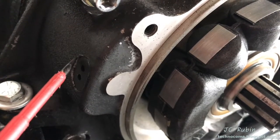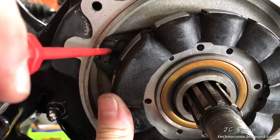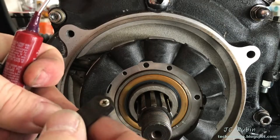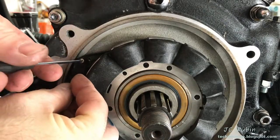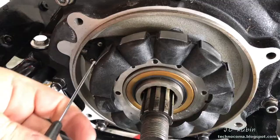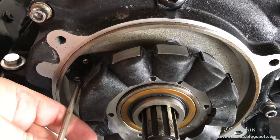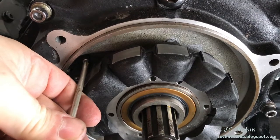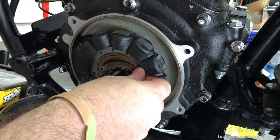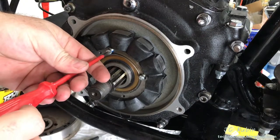At this point I just have a little bit further to go and I completed that. I'm going to turn it so those two wires are centered and flat against the case. Putting a little dab of blue Loctite on the end of the threads of these screws because they're so incredibly small - that will stop vibration from loosening them out. I tighten them down. There are then two brackets with flathead screws that need to be added to hold the stator in place. The bracket is then dented into the flats of the screws on at least one side to ensure they stay and can't turn.